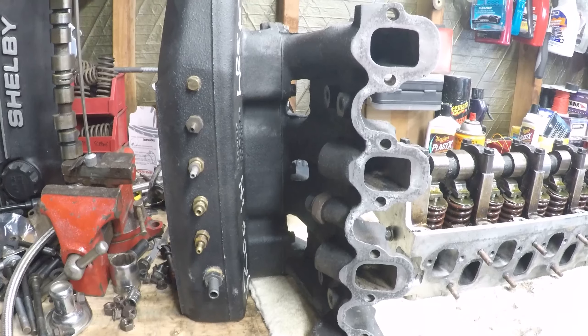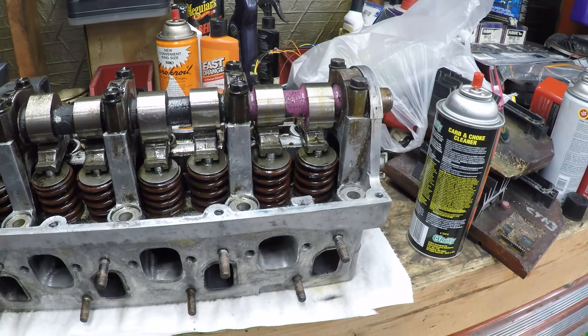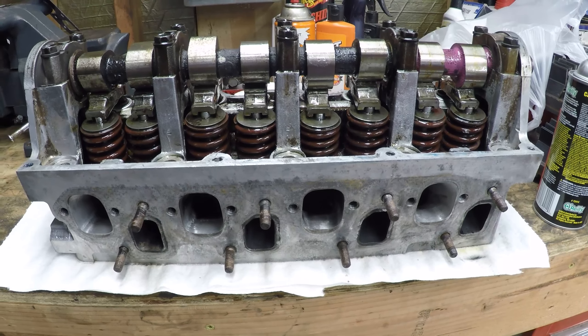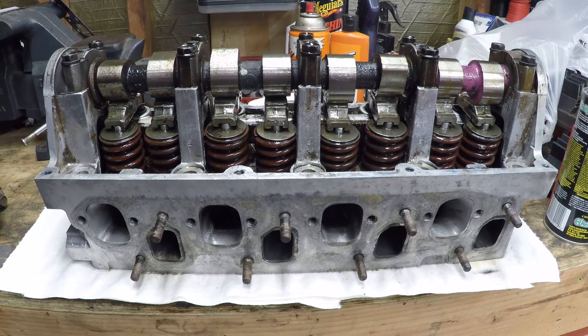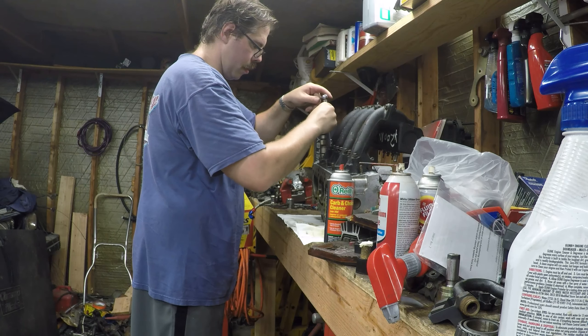Behold the cheap two-piece intake that's got way too many ports for vacuum lines installed in it. With the head cleaned up and valve train re-lubricated, I'm going to install the exhaust manifold and the intake manifold — frankly the same ones that were on it; I just took everything off to get it cleaned up. A lot of this stuff is pretty old school, some salvaged because it was partially ported. Since this whole project started because somebody didn't torque down the intake manifold bolts properly or use sealant on the ones that go into the head bolt passages, I went ahead and made sure there was ample sealant on all the bolts and that they were torqued down properly.